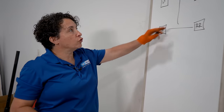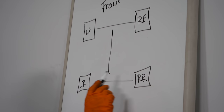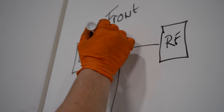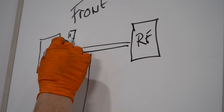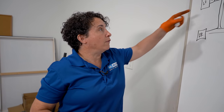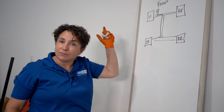I'm going to do a real basic drawing of what a car looks like. You've got left front, right front, right rear, left rear — those are the wheels. Each wheel has hydraulic fluid going to it. If your master cylinder is over here, you could have brake lines that feed just the front, and another brake line that feeds just the rear. That's a normal brake system. What you do is follow the lines — furthest lines go first. You always want to start at the furthest point from the master, so all that fluid pushes the air out, and then it compensates on the other side. The shortest distance goes last.